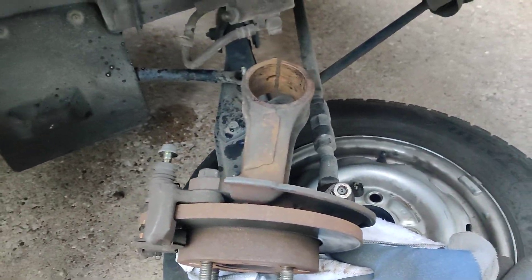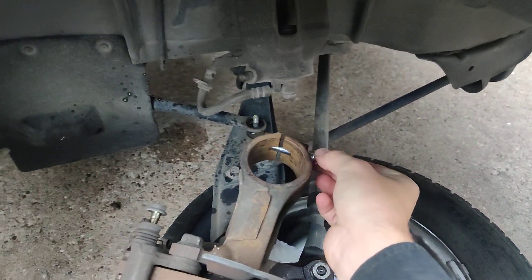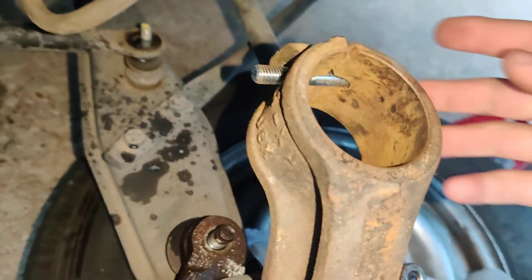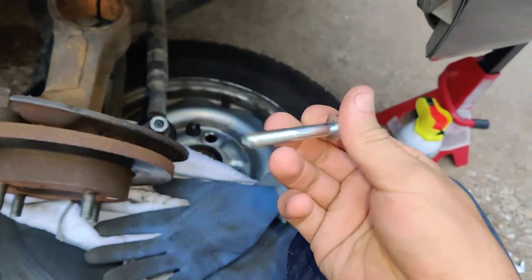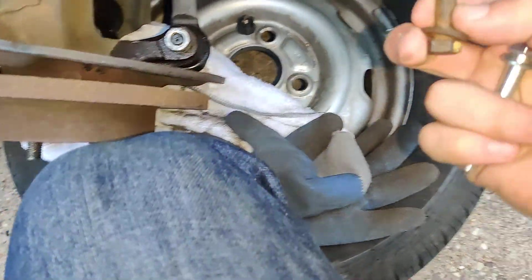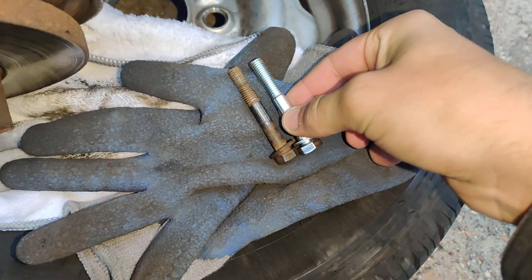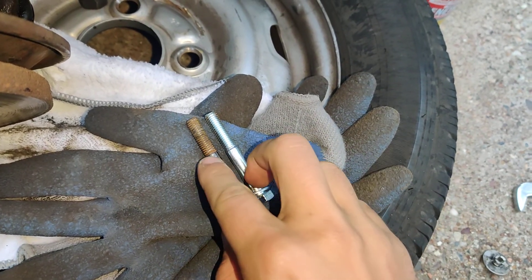What I'm working with here is I bought some replacement knuckle bolts that go through here. As you can see, it doesn't thread. What's very interesting is if I compare what I took off the car, it is perfectly identical in thread and size to the replacement — just a little more thread on this one, but not really a huge deal. Grade 8.8, good replacement.